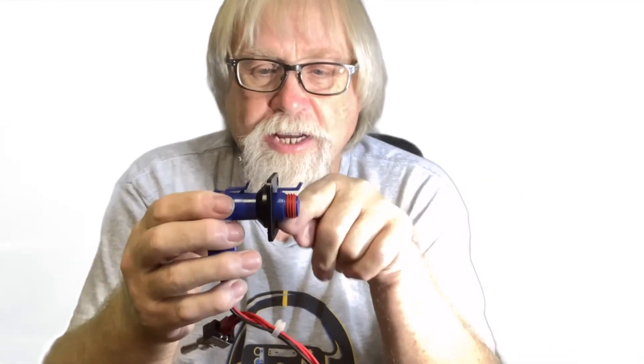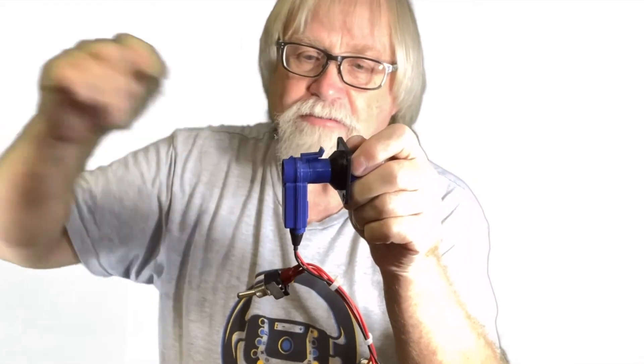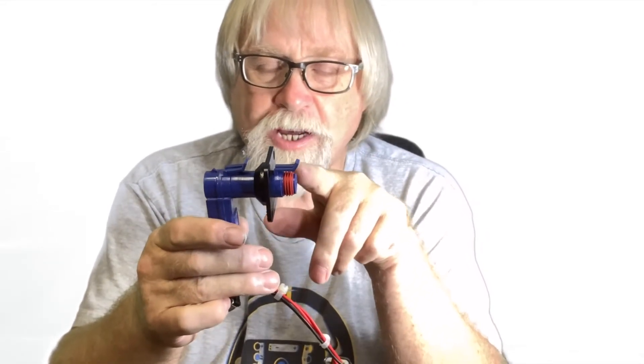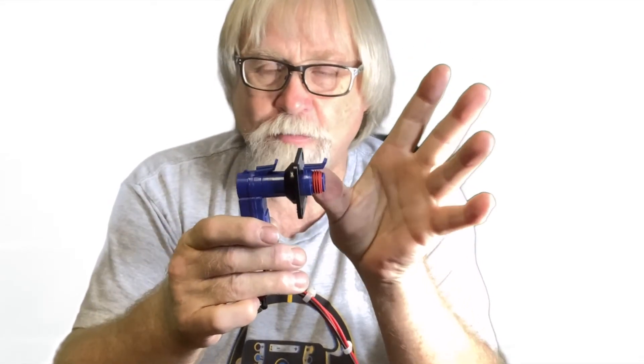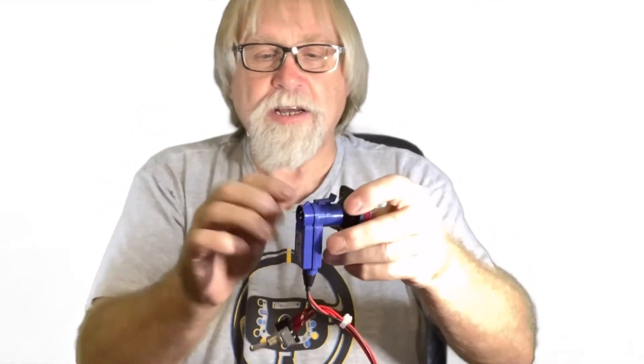If you get the pin connections breaking down in there, you lose everything downstream from where the connection breaks. So always go with a straight cable. If you can use a six-inch cable with modules inside, and the same on the outside, stack them together — there are brackets available online to hold them together, or you can tie-wrap them together and tie-wrap to brake lines or something running along the firewall.